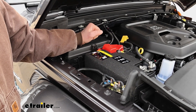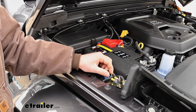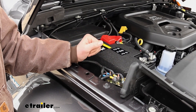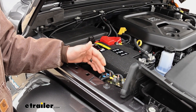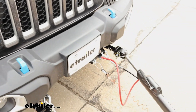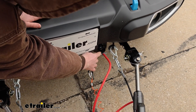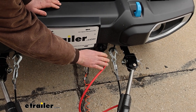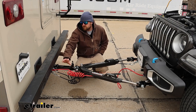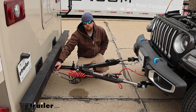The way this works is you're going to have a wire coming from your battery and the power's coming into it — it comes from a breaker, which will protect your system in the event of a short. The battery is going to receive power from the motorhome, so that power wire is going to run all the way down to the front of your Jeep where you have your cable plugged in. You are going to need a six-way round type connector to properly hook up this charge line kit, which is a very common type that most people use anyway, and it's going to receive the power from your motorhome seven-way.